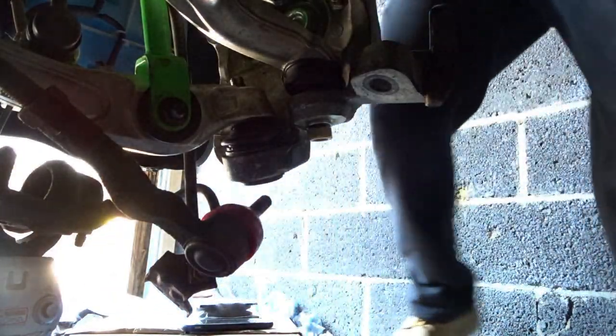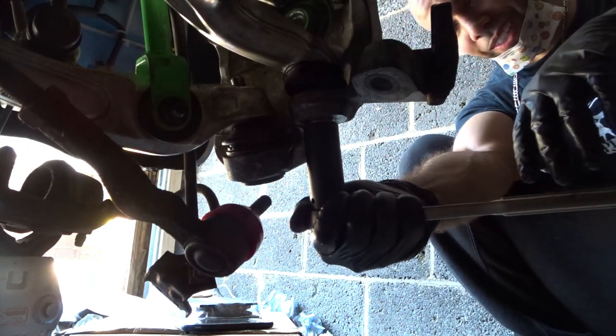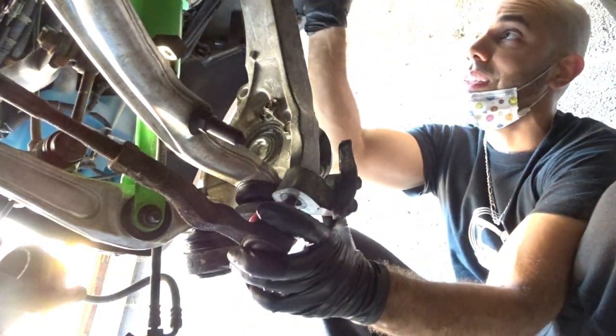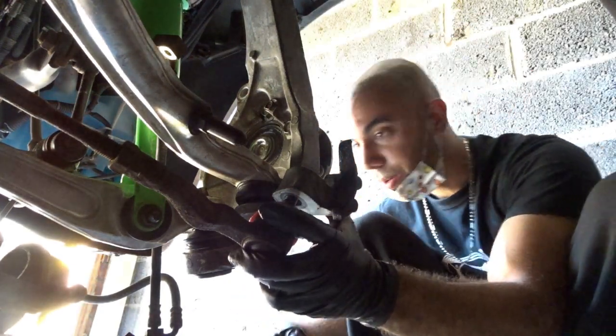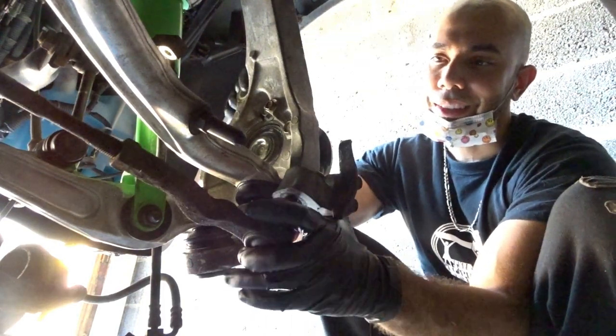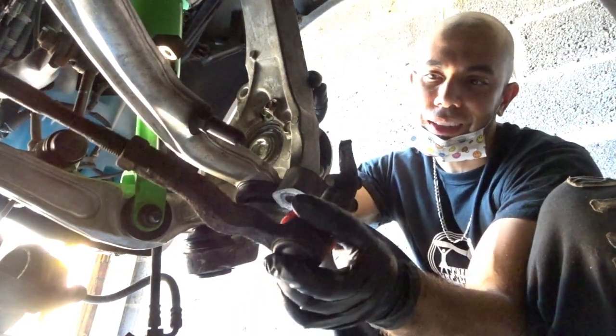This lock washer is the real deal. If you ever have a spinning issue like I had in my previous video — I'll put a link below — this is working out great. Being that I'm already here, I'm going to put the tie rod in just a little bit so it doesn't rotate as I tighten the upper control arm and radius arm bolt. I'll tighten it down later, but I want the flexibility to do the brake lines nice and neat without having to go inside and turn the steering wheel. I'd rather leave it loose so I can rotate it myself.